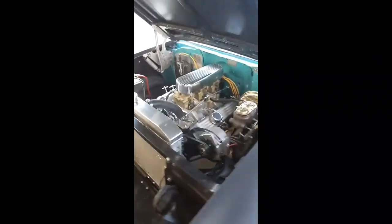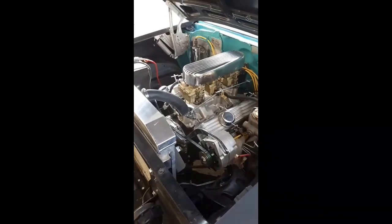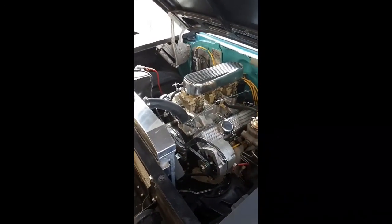And basically I had this old 350 in the garage, and it's just a 30 over 350. It's the O'Reilly short block. I had a set of 202 heads. I had them redone, which is probably kind of foolish on my part because they're the ones without the alternator hole in the front, but I could have probably bought aluminum heads for what I put in money in those.